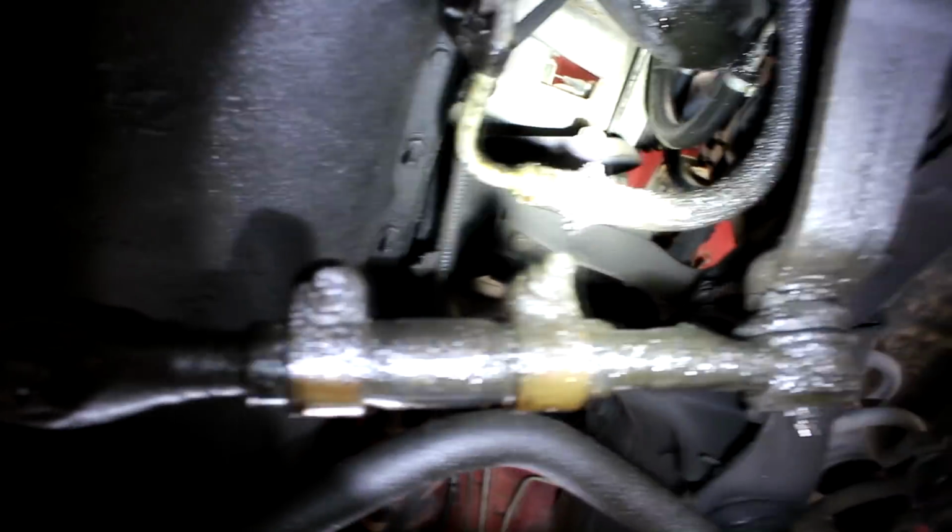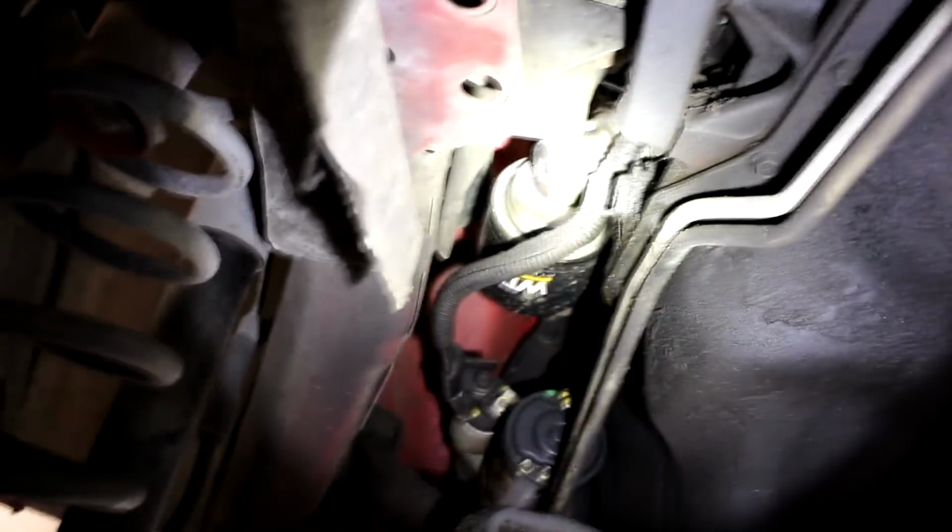It looks like these cooling lines might be leaking too. Let's see here. Yeah, I believe that transmission line's also leaking, so that's part of the reason I was not finding fluid in the tranny. But anyways, those are the cooler lines. They come from the transmission and come up here to keep it all cooled off. So let's go back here.